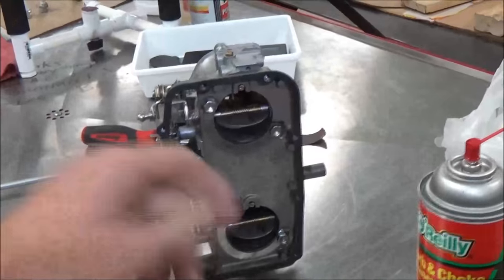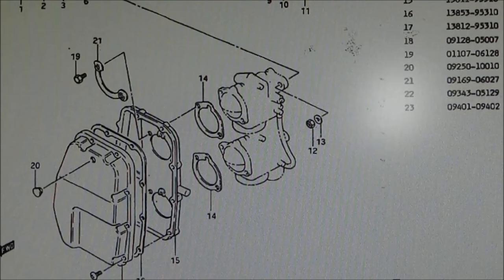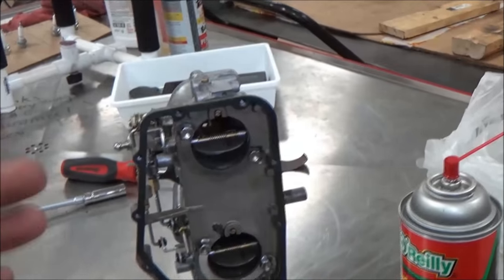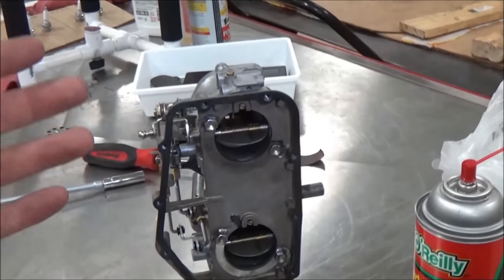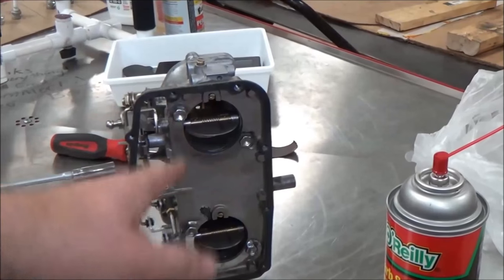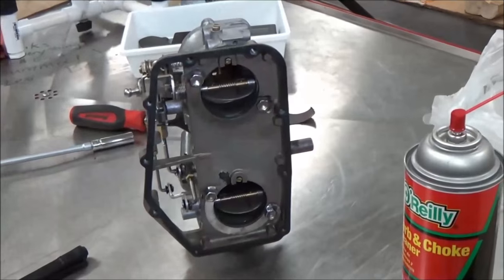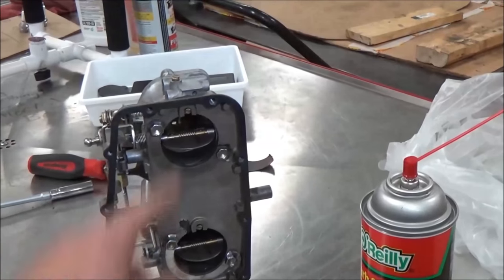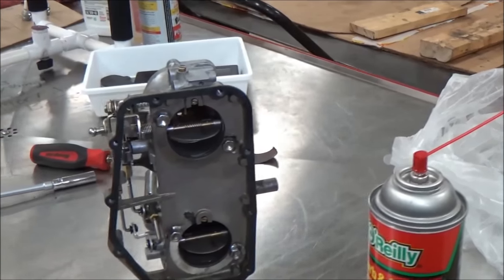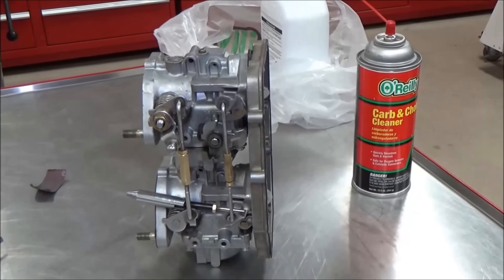We have a nice good tight seal all the way around. What cracked this airbox was literally not using all the parts. The two gaskets required are part number 14, as you can see in the microfiche here — from the microfiche picture, you can see gaskets are clearly required. A lot of times people think 'no big deal, this doesn't have an air filter anyway, I can live without that gasket,' but taking the time to do it correctly obviously wouldn't have damaged this part.